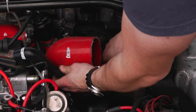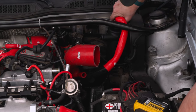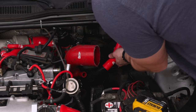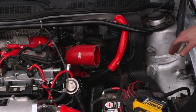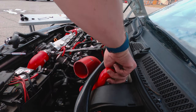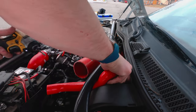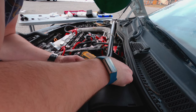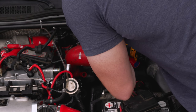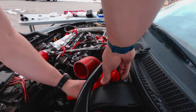It's kind of cool and ironic just how well this hose actually works for this. The bend is just sharp enough to clear the chassis stiffening brace, so it's not kinked or compressed whatsoever. Since the catch can sits back here, we're even able to still run the intake with zero fitment issues, meaning we're ready to mock this up with hose clamps. Trying to get this kit to work with this car was a gamble, but I love it when a plan comes together.